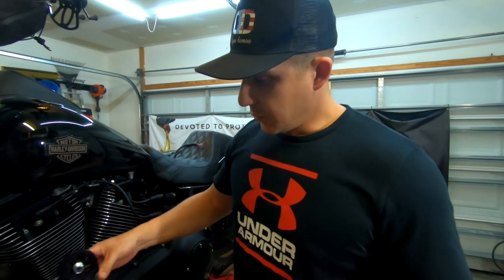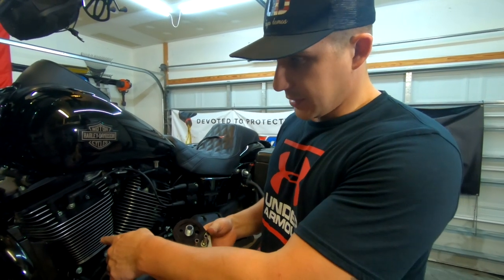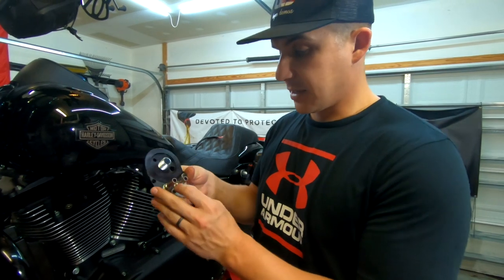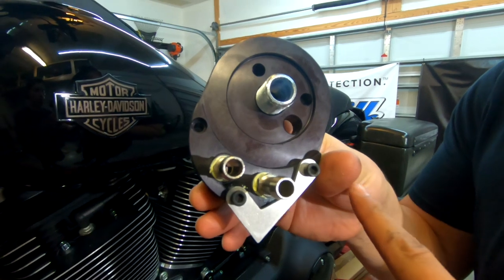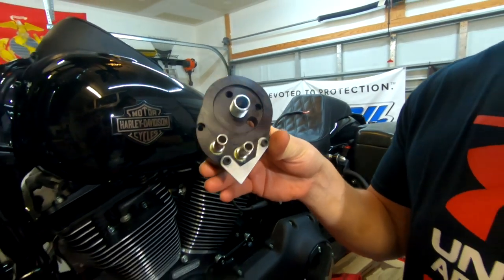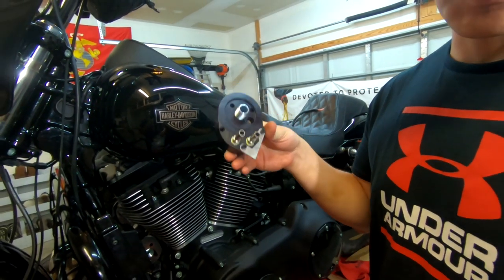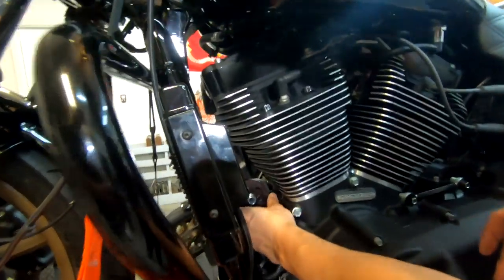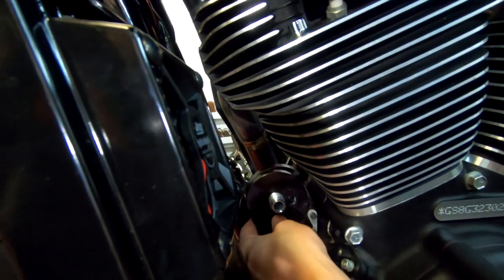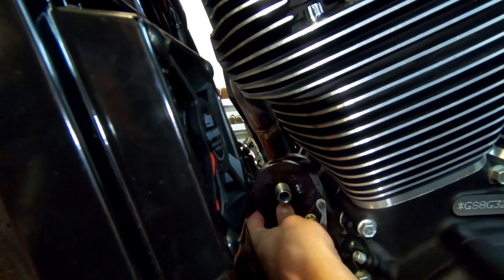All right guys, so we got the inside part of the adapter on. On the outside, you have to put this anti-rotation bracket right here. For a Dyna, it's orientated like that. And then it shows you for a Sportster, a Softail, where you would put it. So what it tells you to do is put it on here and then turn the adapter until it contacts